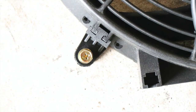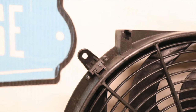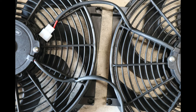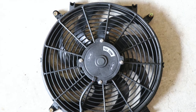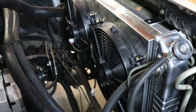Next, I'm going to prepare the fans for installation on the fan shroud — it's pretty simple. Cold Case provides CAD-plated screws to attach the fans to the back of the radiator shroud, and also four plastic feet per fan that slide into already cast-in grooves in the outer housing of the fans. The fans will only mount to the shroud with proper spacing if mounted with the flat surface facing each other. To keep wiring as clean as possible, route the fans' wiring to meet in the center. To finish the fan installation, insert the eight supplied bolts into the pre-installed nutserts on the radiator shroud and hand tighten.